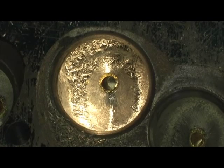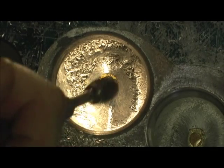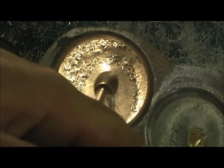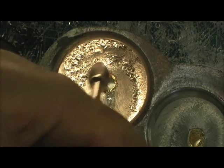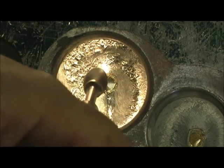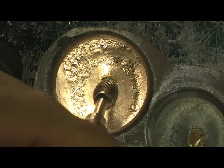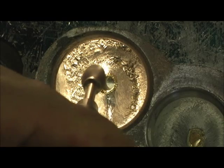I switch burrs again — this time it's a carbide cutting burr, and I'm going to let it dance right on the top of that guide. Because you do not want to take your aluminum burrs and cut on it — it'll tear them to pieces. I'm doing it in a circular motion. All I'm doing is rounding it, pulling it down to the aluminum.